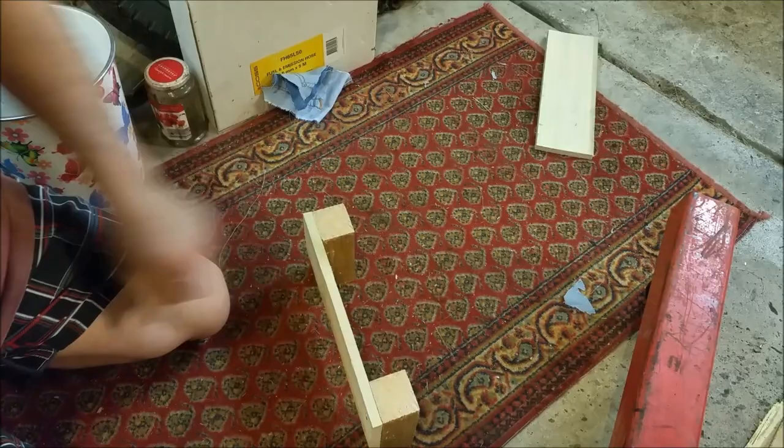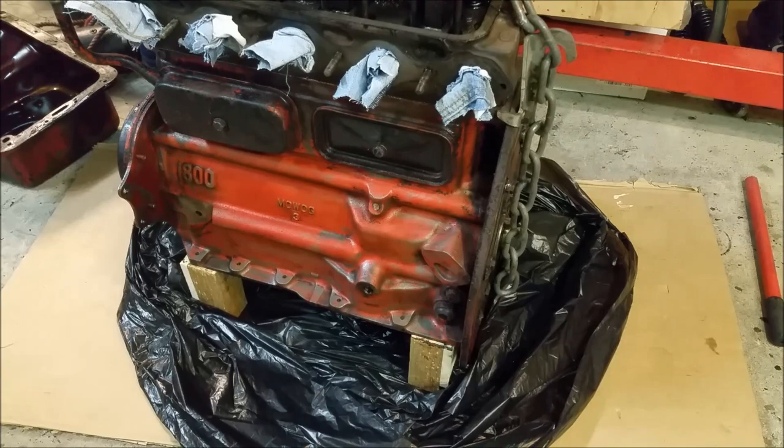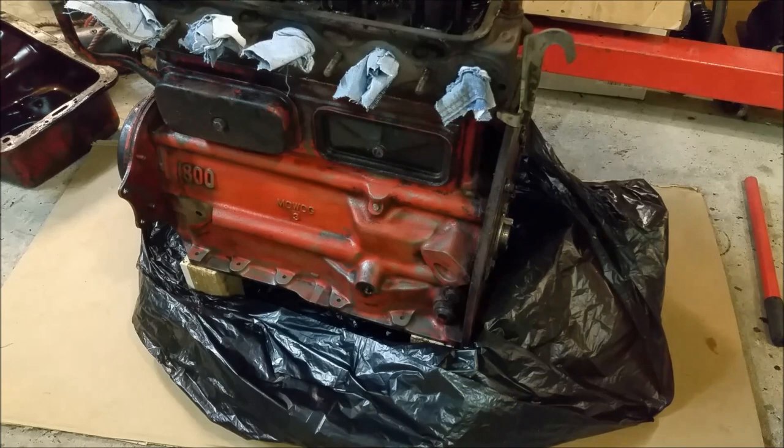That's the front one. I've got that sitting on its blocks — it's rock solid. Now we can take the back plate off and replace the rear main and the gasket, and take the timing case off to check the timing chain. I've got a large garbage bag sitting under it to keep all the dirt out. I'm just gun-shy of those threads at the back — maybe it's paranoia and there are BMC mechanics laughing at me, but I'll cop the ridicule.